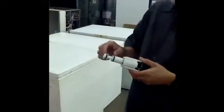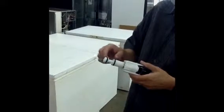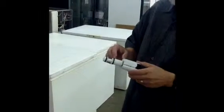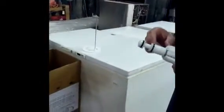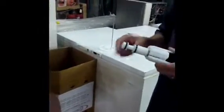Handle with the two O-rings, and once a week you take the O-rings off and make sure that they're not split, because if they're split, the product will leak through the handle. Yeah, it will leak through the spout area here. And when you're putting these back on, make sure you put a liberal amount of this lubricant on each O-ring.